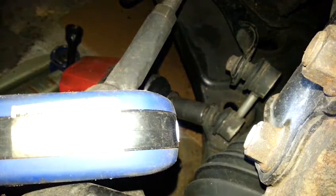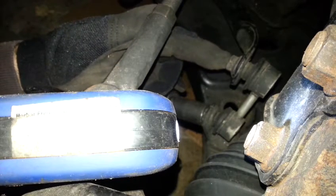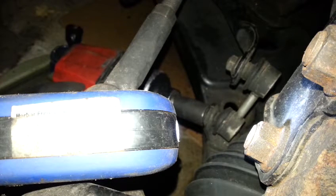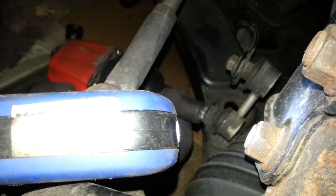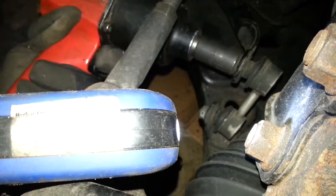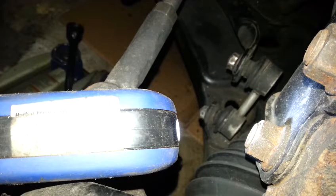So, 14mm on the sway bar end links. There is a way with an Allen to work inside of that spot with a box handle on the outside, or a crescent wrench, whatever you got. But usually you can just get lucky and blast them off with a 14 impact. Not going to get lucky — you got to do it the hard way. Well, at least I knocked them loose, so I can come back with the other tools.